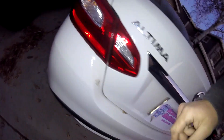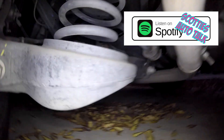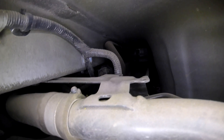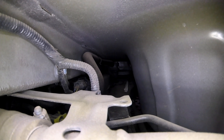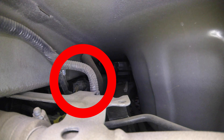Now, if you're having a problem pumping gas or getting gas to enter the fuel tank, you might be having a problem with your vapor vent solenoid. That's going to be easier accessible through your driver's side rear inner wheel well. It is kind of hard to see. While you're in there looking at your vapor vent solenoid, make sure your vent hose — the hose leading from the solenoid to the air filter and into the air — isn't plugged. It's common for spider webs, rodents, or something to get inside that hose and clog it. The computer is very finicky, so always make sure that hose is nice and breathable. I remove it from the vapor vent solenoid and clean it out when I'm in this area, because it is super common. So here is your vapor vent solenoid.